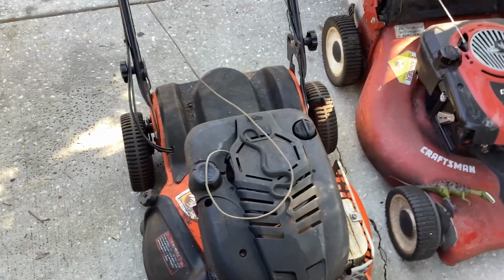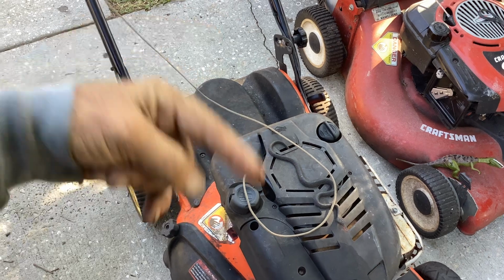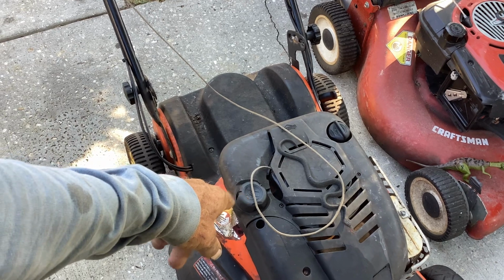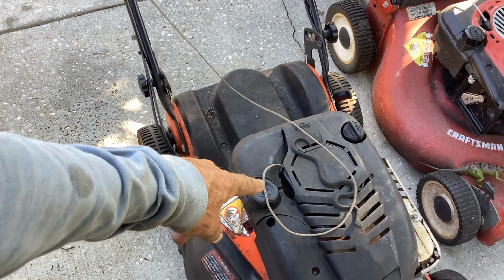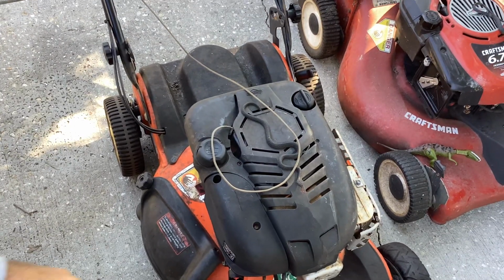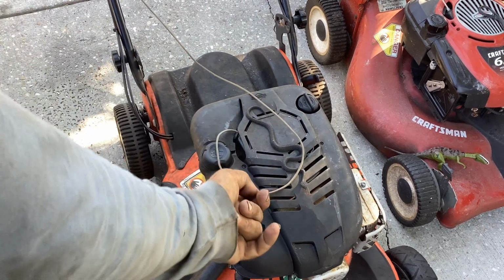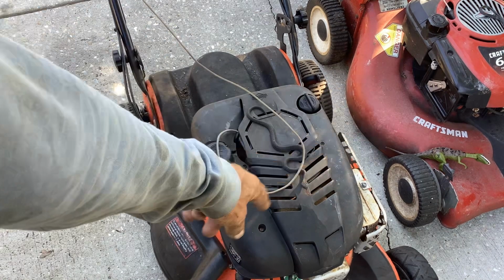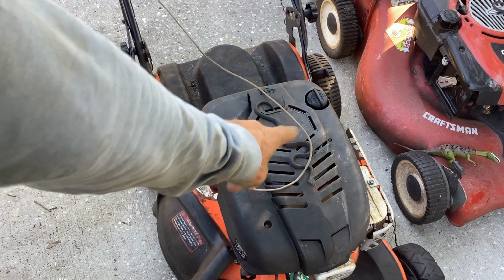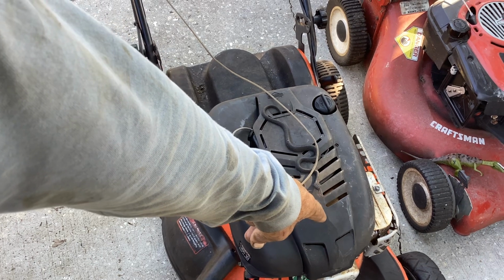So we're dead in the water. The spring must have an issue. It must have grabbed itself and let me spin it back three or four times, giving it a tug right now. Unsprung it. The issue with this older style overhead valve is the recoil has a funny bump on it. The exhaust actually comes out of the top of the head and then goes out. So you can't use a standard quantum style recoil on this. It's a different shape recoil here in the front.